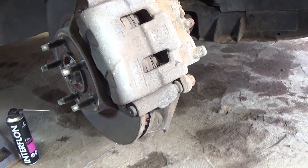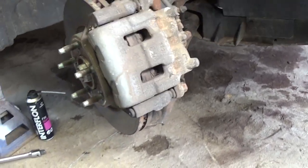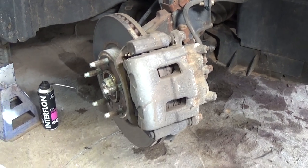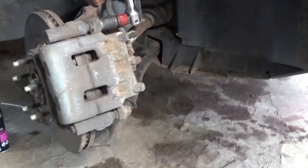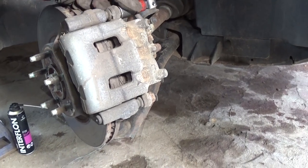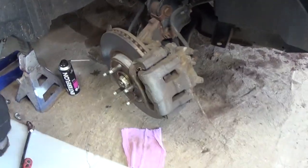This one is really, really tight. You have to be careful not to break your bleeder valve. We will get bigger tools because obviously this one hasn't been removed for a while. We will have the torque specs on the channel. Whoever installed those — that's just a ridiculous torque level, it shouldn't be that way. It came loose now finally.